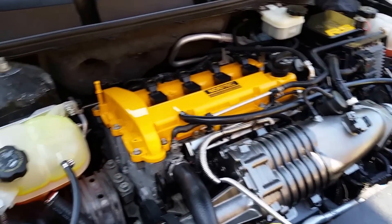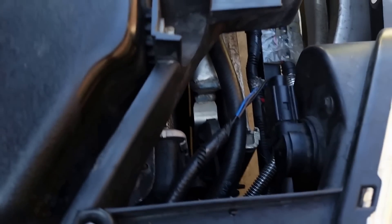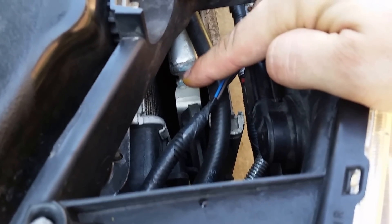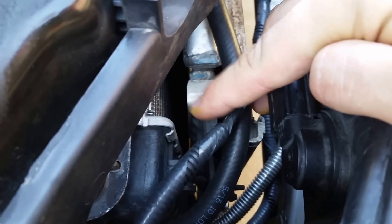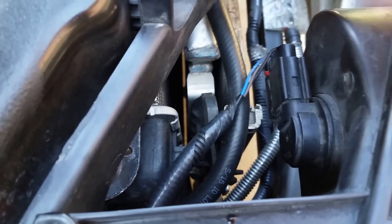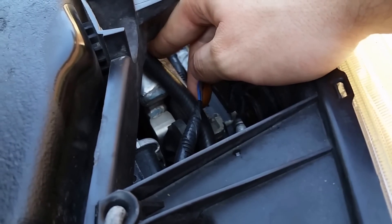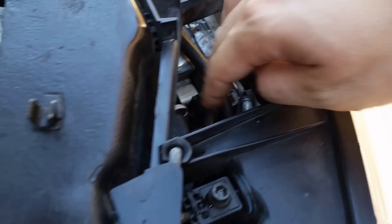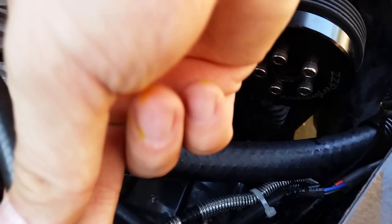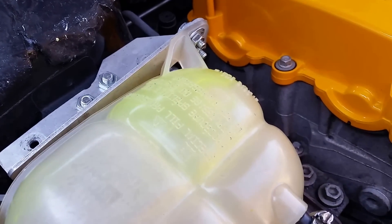Pretty much the setup is Option B, as you can tell. Stock LSJ heat exchanger just sits in the middle. I had the brackets with my stock radiator so it just bolts right in — very simple. I put a barbed elbow fitting on the top bung, connect the hose to it, it goes through here and comes back out there into the top, so there's a stream of coolant that will bleed out all the air bubbles from the system.